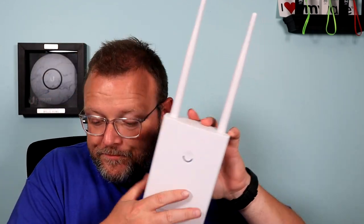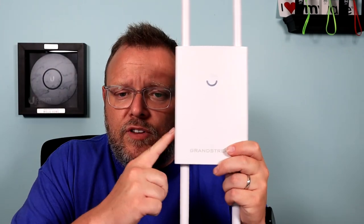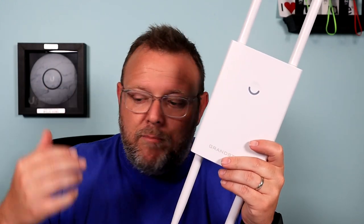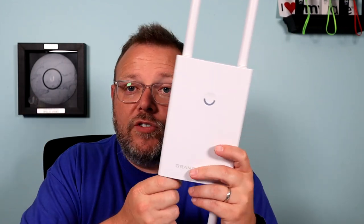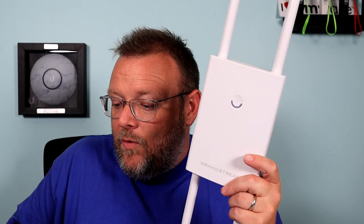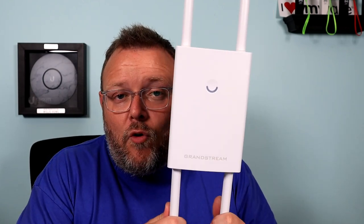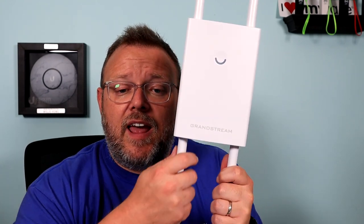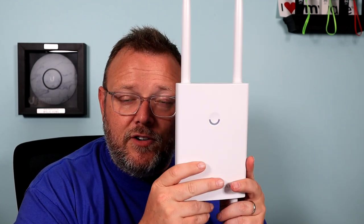The next video will actually get it fired up. But real quick, let's go over the specs. Every manufacturer does a combined throughput on the wireless side — combined throughput is about 2.33 gigabits per second. Are you going to get that? No, one client is not going to get that. This is 4x4 MU-MIMO. It is PoE or PoE Plus Plus. It can have 200 concurrent connected devices — that doesn't mean everybody's transmitting data at the same time, but you can have 200 associated devices. It does have up to a 300 meter coverage range.